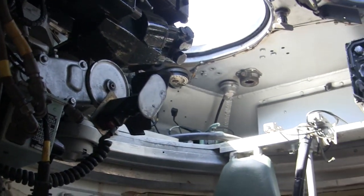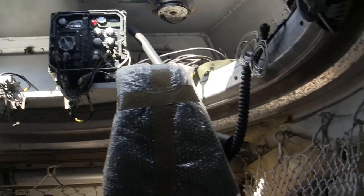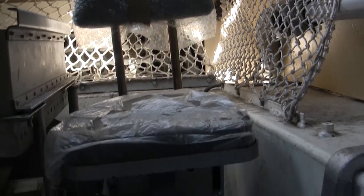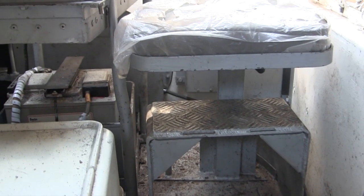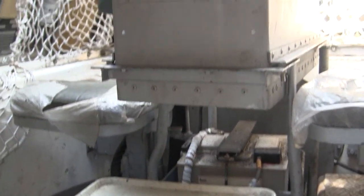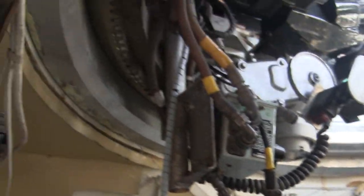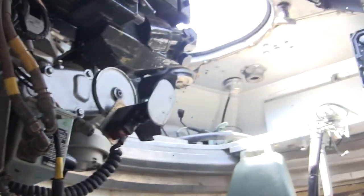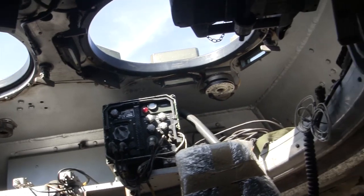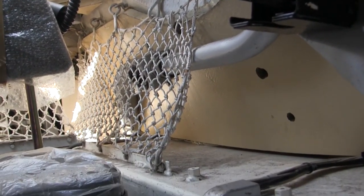That's pretty cool. It's got a 24 volt system, you got 2 batteries in the floor, that's the hull, but then you got 2 more in the turret. A lot of times when they were sitting on certain duties, you would have the hull power switch off. But the turret could turn theirs on and still work everything in the turret. Their interior lights and all that. But when I turn on the hull power and start it, it will charge the turret batteries. There's a box on the side where everything goes through it, and then it comes out and it charges it.